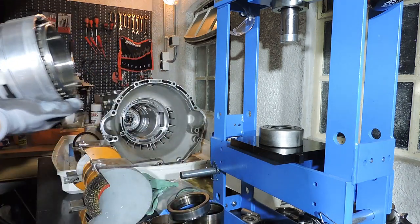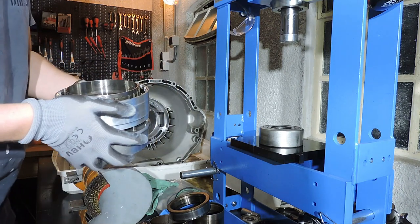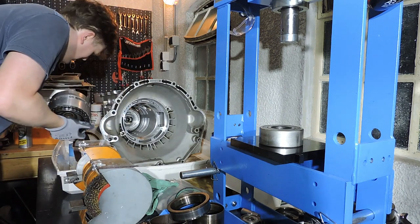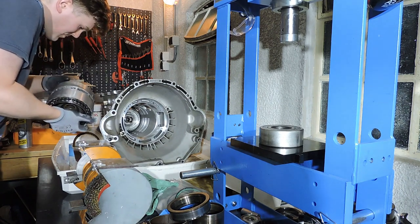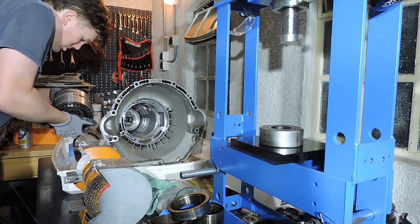Good clutch action. And this is how you test if your clutch and piston is properly functioning. So now we're going to toss in this DG drum. The DG drum is actually held in place by three big Torx bolts as a center support. I'm going to lubricate the rubber seals a little bit that I need to slot in.